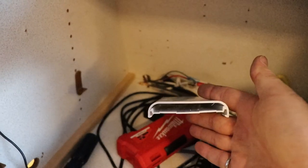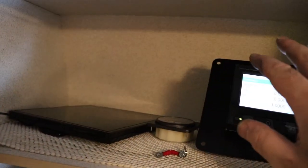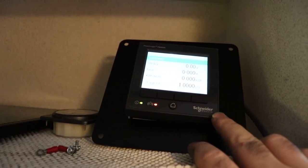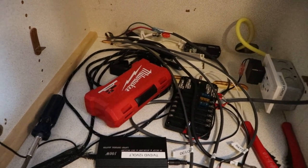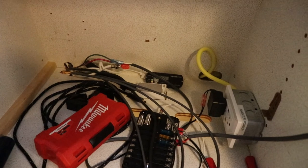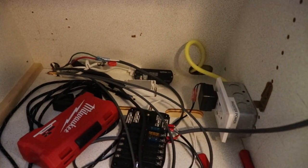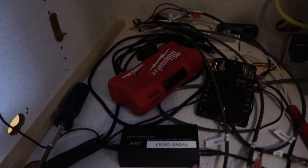This is the tray or trough that I'm using to run the wire up into the vehicle. These two shelves are firmly installed — I can't take them out. My original hope was to put the electrical console up here, but then I'd have to run all the wiring through this cabinet, and I need to make it safe because I have 120 volts going to this meter. So it looks like it's all going to be down here in a box of some sort. I chose not to run the wiring in the wall because on one side the wall is the exterior of the van — I didn't want to risk damaging the van. Like I did pull this wire for this receptacle here, but I decided it wasn't worth taking the risk. I'd be better off making a trough and then I can run all the kinds of wires that I want up here without any trouble.